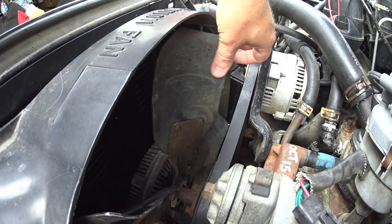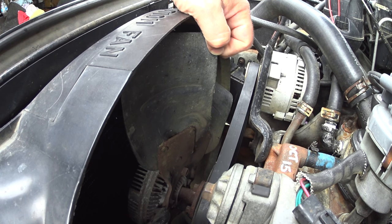The fan blades are the same pitch for a severe duty and a heavy duty fan clutch, so I don't have to change my fan. Now, let me tell you about vehicle speed and how it affects cooling. That fan above 40 miles per hour — if you could magically reach inside your engine and throw it out the window as you drive down the highway, you wouldn't need it at all. Anything over 35 miles per hour, the air going through the front of the vehicle is enough to cool the hot coolant coming through the radiator. So you don't have to worry about a fan clutch issue if you're seeing heat problems driving at 50 miles per hour. If your vehicle is overheating on the highway, do not look at the fan clutch — the fan does no work at that point.